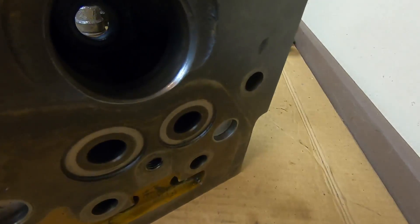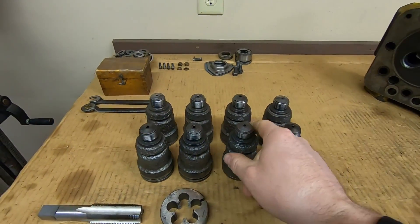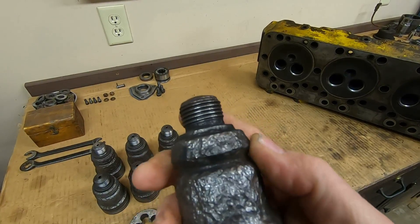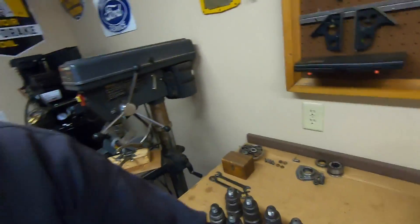We finally have a fully disassembled cylinder head — all four chambers out of there, what a good feeling. We've got two sets to choose from and just need to get four good ones out of all eight. This one suffered the most thread damage coming out of 2115's old head, but it cleaned up a lot better than I thought. We put it through an Evapo-Rust soak for about a week, got everything cleaned out inside, then soaked it with PB Blaster and a couple of homebrew penetrating oil mixtures for about three weeks after that.